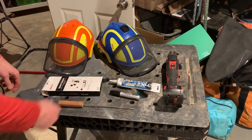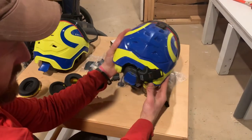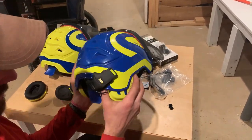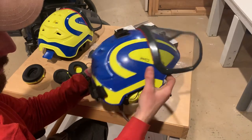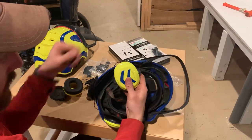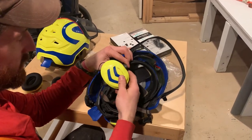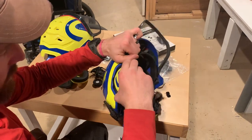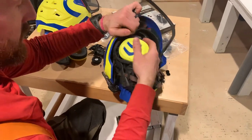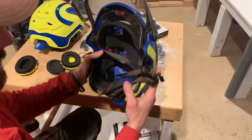You've got to pick an appropriate spot on the back of your helmet. These Protos helmets are not the best for this, but I like to mount them sideways on these Protos helmets. We love the Protos helmets, so even though they are a little trickier to mount Senas, they're still worth it. Then you've got your muffs which come out really easily — that's where you'll be wiring your speaker. You want to make sure that when you move your muff back and forth the wire doesn't get yanked out or pinched.